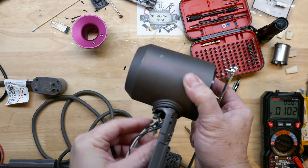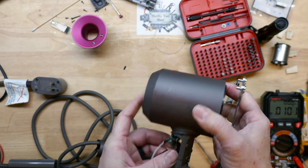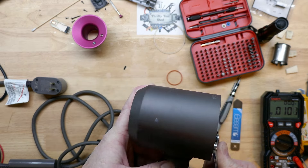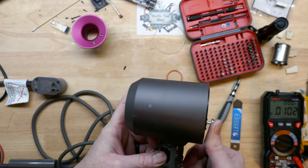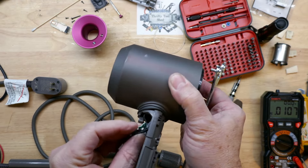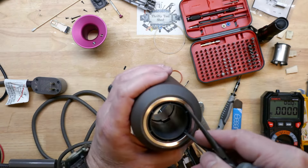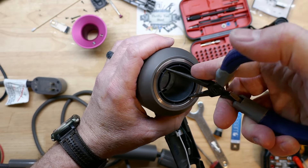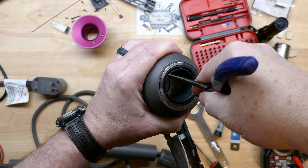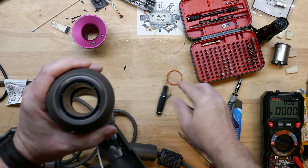I'm making sure the wire in the switch is not catching on anything. It takes a little bit of force to get it to bump off the stop and the little lock, and after that it turns fairly easy. Just make sure you're not pulling too hard as you turn. Once it starts, make sure the front is turning also — they should turn together if you keep the two halves tight. If the front did not pop out, use the pliers counterclockwise and there we go — out of the groove.